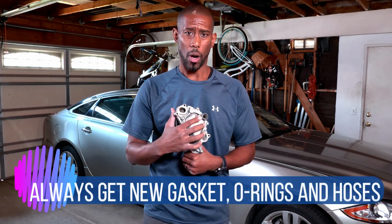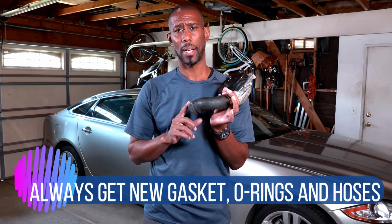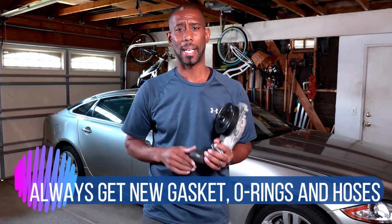As you see, that was a piece of cake to take the old one off and put the new one on. It took me roughly 40 minutes to do the entire job. It's not an hour job, I'll tell you that. And you can save yourself hundreds of dollars, maybe even $1,000. The thing that I will say is make sure you get all new gaskets, all O-rings. If you need any hoses, get a new hose. As you see, I still have the original hose on my old one. That's because I got a new hose as well.